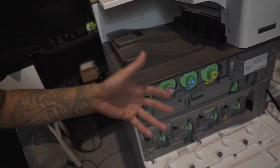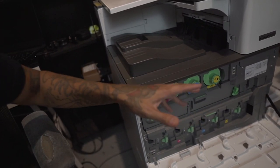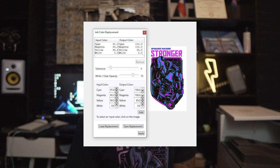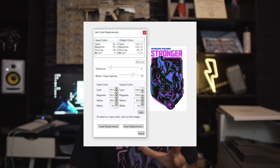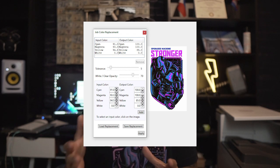Here's something you'd only learn after using this printer for a while: how to make your blacks darker. The iColor 800 has white, magenta, cyan, and yellow toner — no black. It mixes the three color inks to make black, but the yellow hue makes it look faded or grayish. To fix this, use the 'Job Color Replacement' tool in the Pro RIP: click your design, click Job Color Replacement, click the black, then set cyan to 100, magenta to 100, and lower yellow to somewhere between 80 and 90. Play around with it to find what yields the best results for your setup.